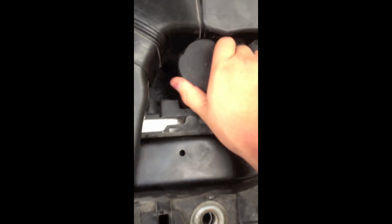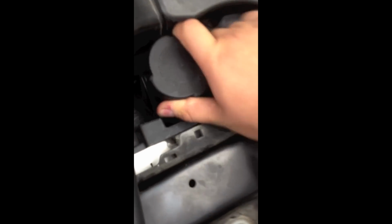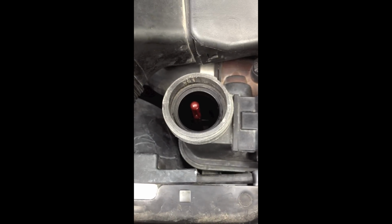So you're gonna want to take the floor pan with the oil pan to the right-hand side of the engine, right beneath the expansion tank. The expansion tank is where you put the antifreeze in. You're going to have to replace the coolant you just leaked, and put some more in there just to replace the fluids. That reading isn't going to be accurate because the car is tilted, but you're gonna bleed it out a bit anyway, so we shouldn't worry too much about it.